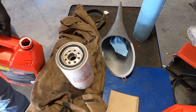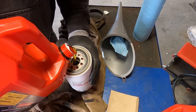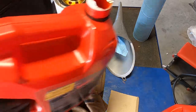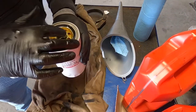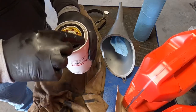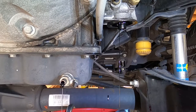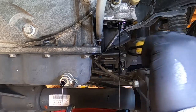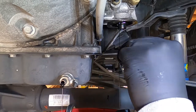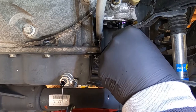I like to put a little bit of oil in the oil filter before I put it on — it just makes it easier. That way when the truck starts it doesn't start dry, it's got at least a little bit in there. Also oil up that gasket so when you put it in it slides in nice. Something important: every time I change it the old gasket gets stuck on there. Make sure you feel up there and pull that off, because two gaskets will definitely cause a leak — ask me how I know, because I've done it.